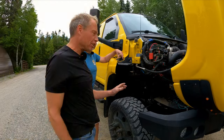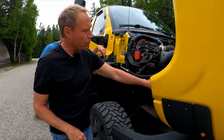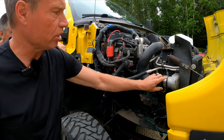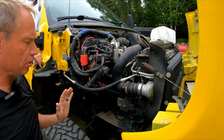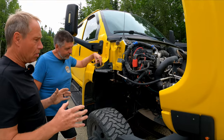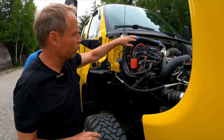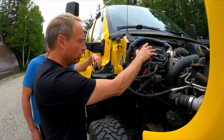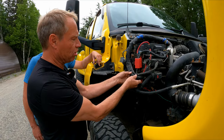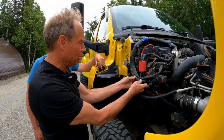On this side, we've moved the cover to show you a better view of what we're looking for. We'll check our air-to-air clamps on this side as well - there's a slightly different style of clamp at the engine which has a circlip, but you can see there's no seepage here, this is all looking really well. Now, these trucks are known for some electrical issues, more so in the lower parts of the harness. If you have electrical issues, it's not necessarily the computers or your fuse area - it'll be corrosion in these lower areas. Make sure there's no collection of water, salt, or debris there.